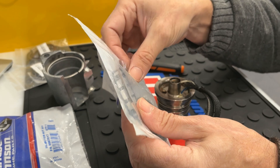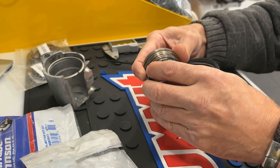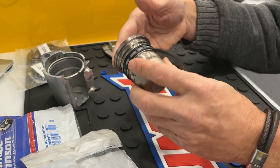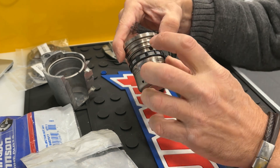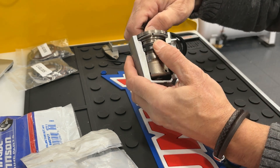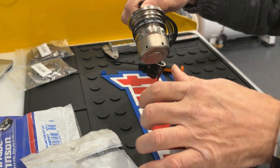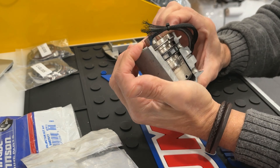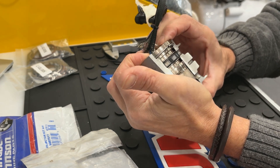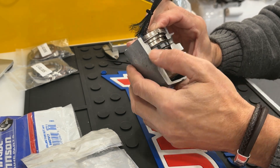The Evinrude filters themselves fit quite tightly, and that prevents them from sagging. That's important because the fuel is actually fed through this supply port right here, sitting inside the injector. The filter seats, the crush ring crushes. The crush ring is very important because it sets the correct depth as well as the correct preload for the injector. And when it's all done correctly, the filter stays in place and does not compromise any of the filtering ability.